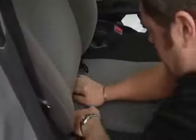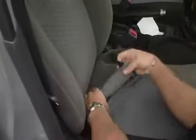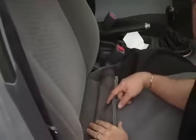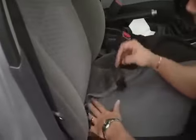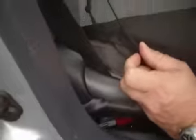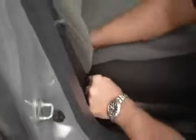Then tuck her back here, tuck the back tab through there. A lot of times we have Velcro along here so that it will Velcro to the back of the seat, because you can stick your hand right through here. This one doesn't have carpeting for that Velcro to attach to, so we've placed elastics — quite often three, in this case only two. So just give that a tuck through there and tuck those back. You've got to use your intuition a little bit here: if it looks like you can get the tension cord down through the seat, the lower down you can get it the better, because that pulls the whole edge down and keeps it from flipping up. If you can't get it through, just put it through between the backrest and the cushion and pull it down to the side.